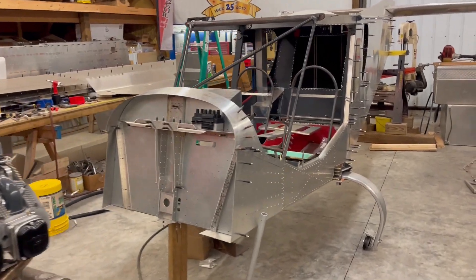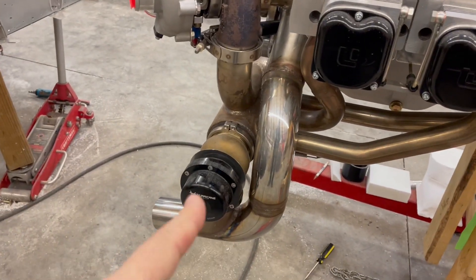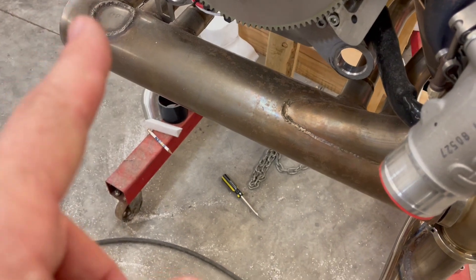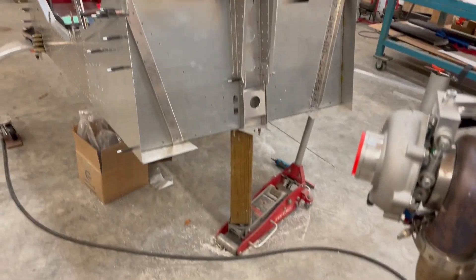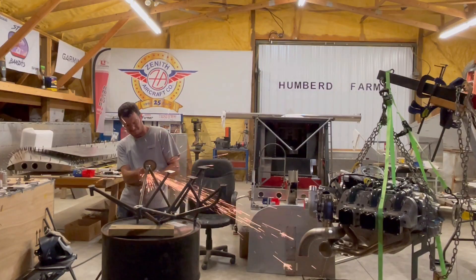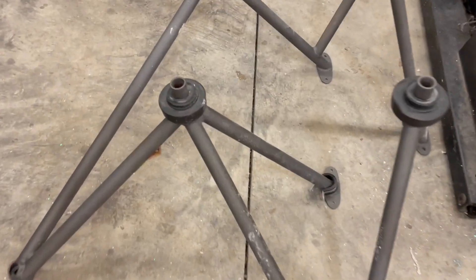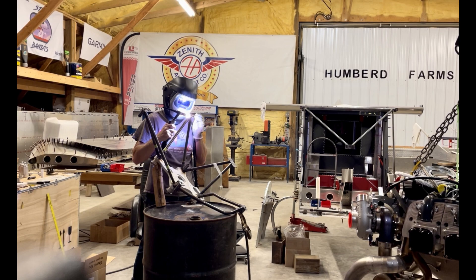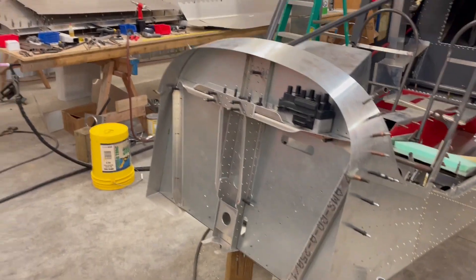I'm trying to get far enough along so I can see how it's actually going to come out. There are a ton of things in the works and a lot of stuff I've already done. I've fabricated an exhaust system, moved the wastegate from the left side of the engine over to the right side so I can make it all come out of a single pipe into a Y-pipe. I've also built a custom engine mount from scratch — it's a very short engine mount. I'll get it cleaned up, put it on the airplane, and show you guys what it looks like in the next few days.